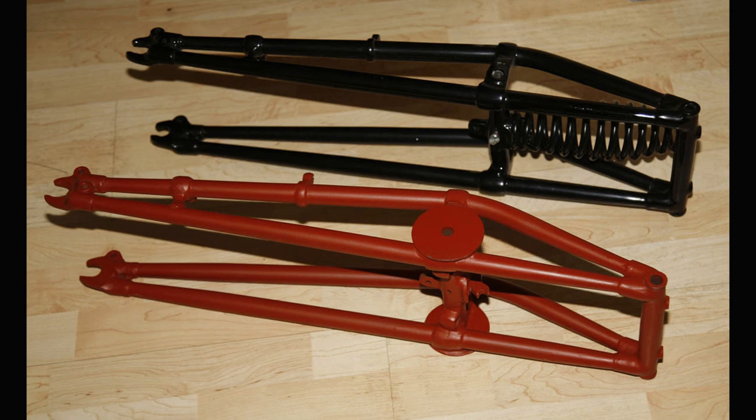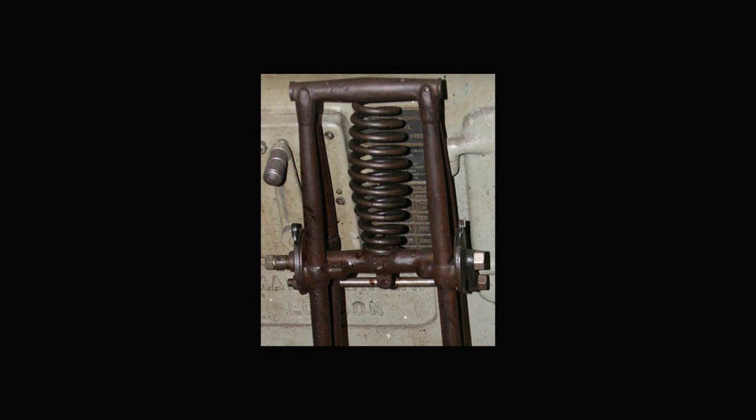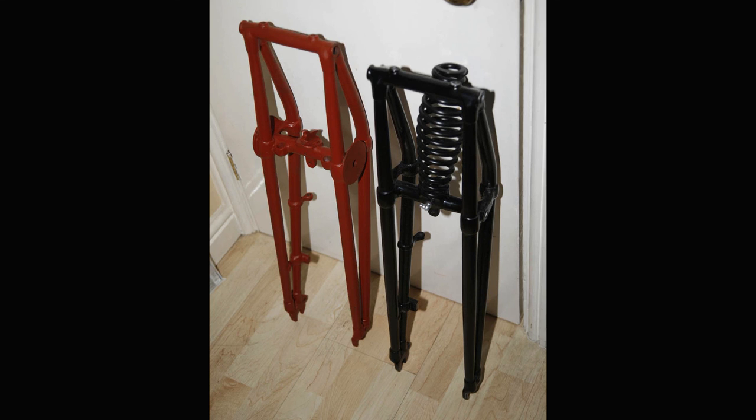You can see the last couple of photographs of fork blades - the ones for this bike, the competition type we've been talking about, next to a set of inter fork blades. They're pretty much the same width, but the inter type have that provision for a damper. There's also one other difference: the inter type have little lugs with holes in them which hold the headlamp brackets on girder forks, and the overhead valve and side valve type forks also have that provision. The competition type don't have that.